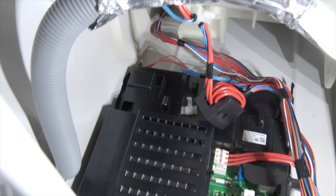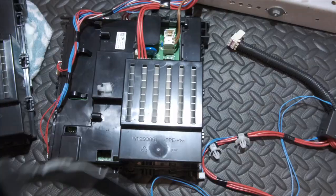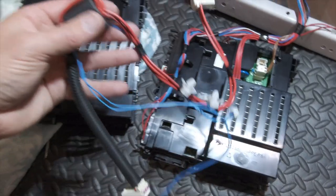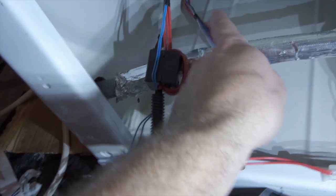Got both screws out. Once you remove those screws, the board is fixed into a little black piece back there. It's got some slots in it — you just push it and it pops right out. Now I'm going to disconnect all the connections. Some of these will go back into the new board, but some will be replaced by the new wiring harness. The new harness is already attached on the new board. Once you untape the wires coming from the top of the machine from the motor wiring harness, you can pull everything apart and see what goes with what.